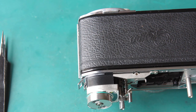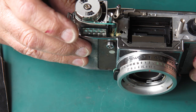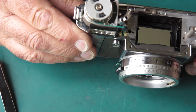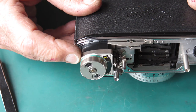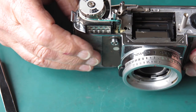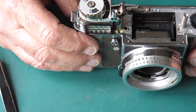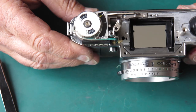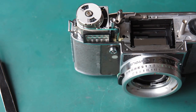It's a little bit fraught — a lot of poking around with needles, pointed tweezers, toothpicks and God knows what else. At all times you have to avoid displacing the meter, which is always keen to get away if it possibly can. As soon as this pops loose on the top of the camera the cord tension is lost, and the cord will take the opportunity to jump off a pulley somewhere. You'd have to take the front off the camera again to straighten everything up. Let me find my gear and get to this nasty task.